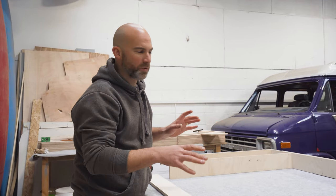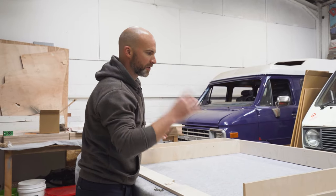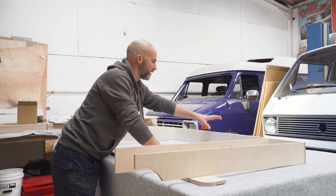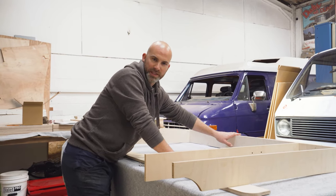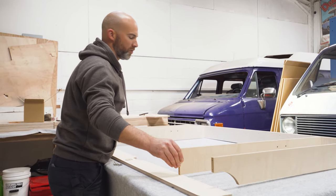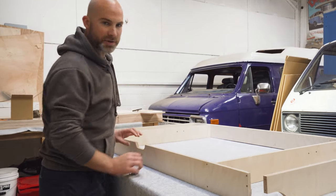The reason we've done it in that order is because if you're constructing this within your van, you're going to want to be able to slide the platform all the way forward, almost hanging out the boot lid, and you need these elements in before you screw on those pieces with the holes at the back. Then, and only then, you can slide the bed platform all the way towards the inside of the van and put the front panel on.